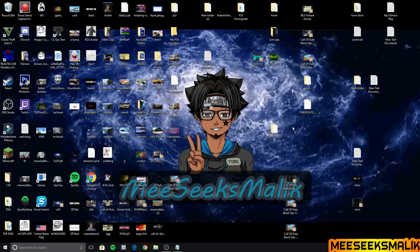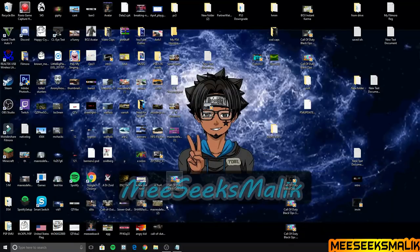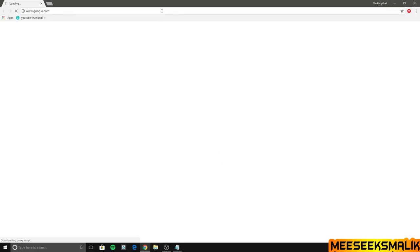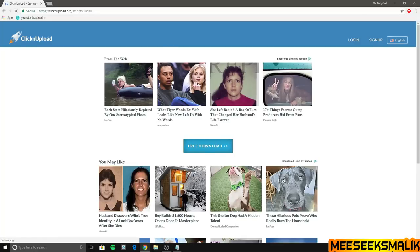To start this off, I have compiled a list of downloads you will need. Obviously you're going to need a computer and a flash drive for this. The first thing will be a lowest firmware checker to see if your PS3 can be downgraded to the lowest firmware, or to 3.55 or lower. If your PS3 cannot be downgraded to 3.55, do not do this at all.